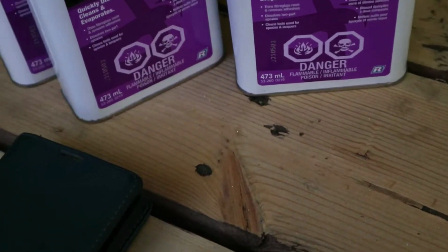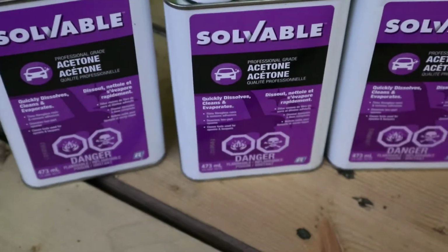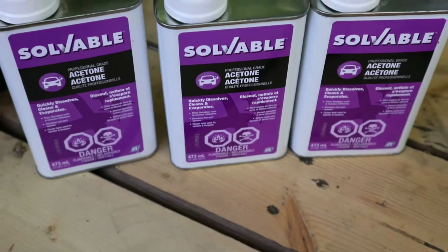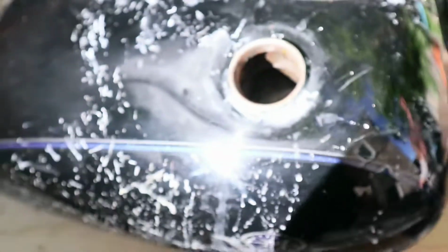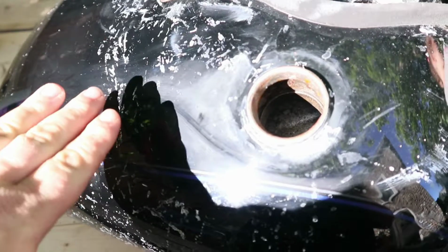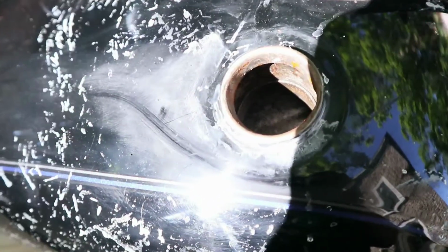Okay, guys. So we got some acetone, kind of leaving off where we left off on the last video, or the other day, I should say. Same video, we're probably gonna put it all as one. We got three things of acetone. I don't think we'll need it all, but I got it just in case. We're gonna pour it in this tank and hopefully that's gonna work. We're gonna slosh it around, leave it on a side, bottom, upside down, and it eats away pretty quick, like 20 minutes. Get this liner out, see how it works.